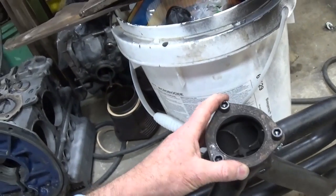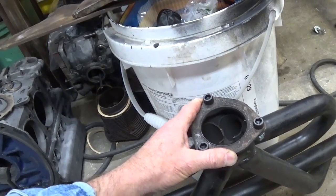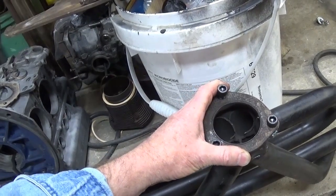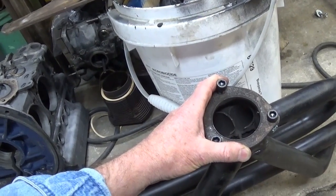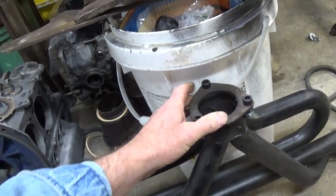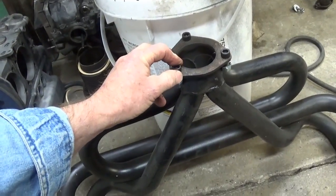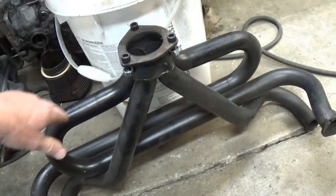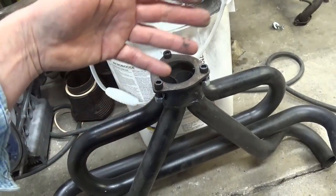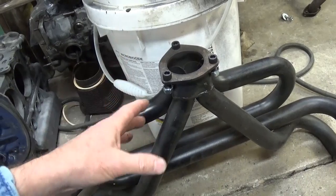When you start getting larger motors, 2 liter and above, you have to start paying more attention to free-flowing exhaust. And it's not a good idea to buy a 1 5/8 exhaust and put it on a small engine. It slows down the airspeed. You will lose the scavenging effect of the header system, which is why you got it in the first place. They run these long, equal tube, equal length headers so that all the cylinders are pushing at the same rate, and it helps with the scavenging effect.